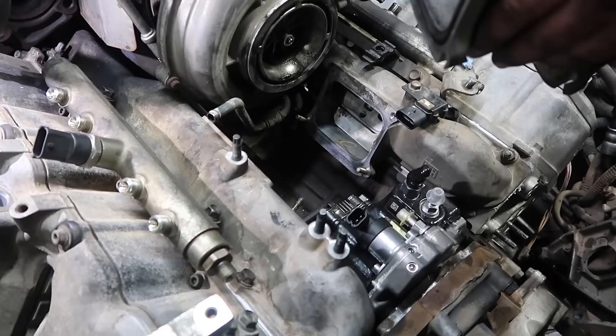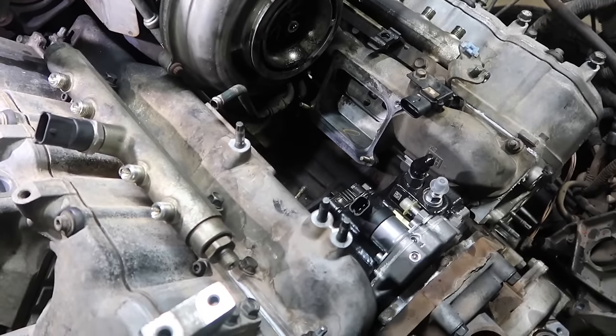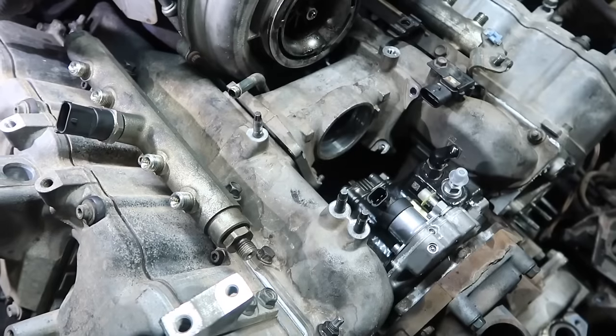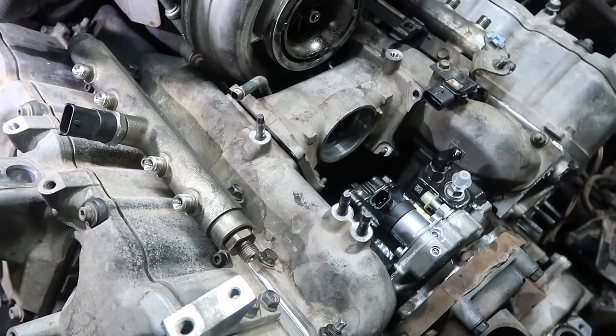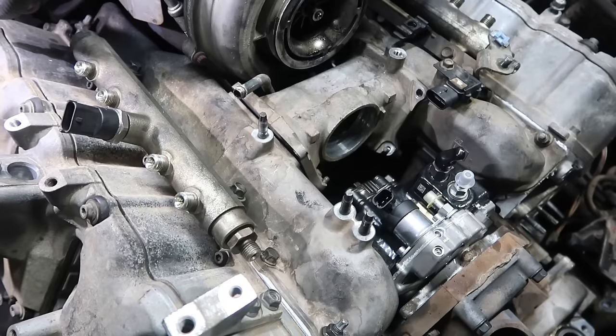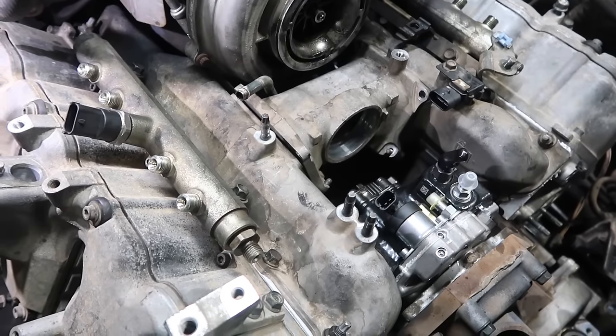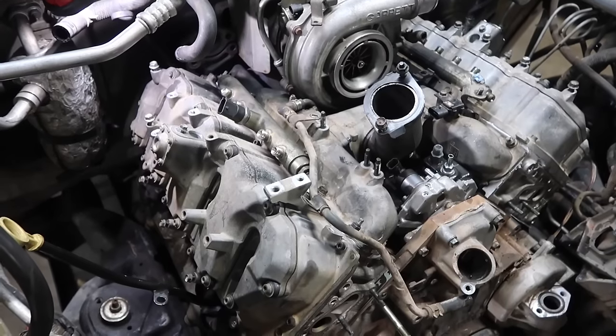All right, next Logan's got the Y-bridge ready and we are gonna drop it in for install. One good habit too, guys, start with the bottom nuts, tighten those first or bring them down to almost tight before you try to force the bolts in at the top side. All right, so we got the Y-bridge in.